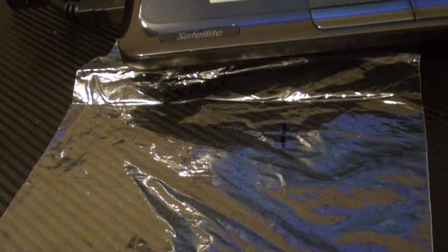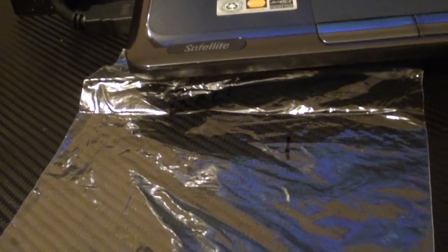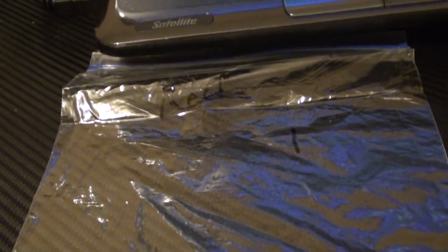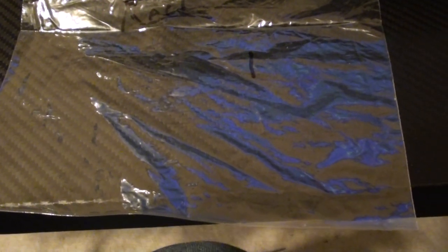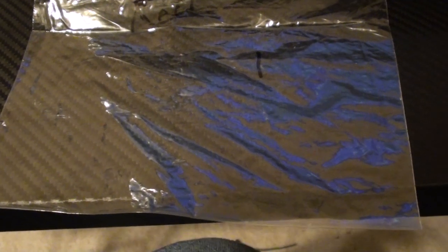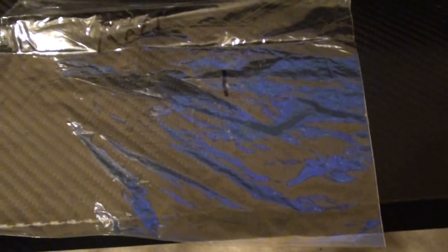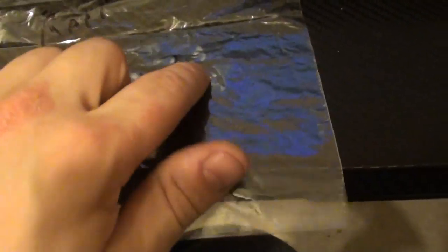Like I said, there are at least 28 steps to removing all of the panels, so you should have bags numbered one through 28. I keep an extra bag for miscellaneous parts. When you go to reassemble, all you have to do is start at the last number and work your way back to one. Especially if you buy one used, parts may have fallen inside the body. For every part, label the bag with the part name and put the screws, clips, and anything that comes off into the bag, then number it as you go.